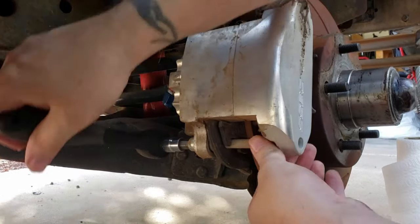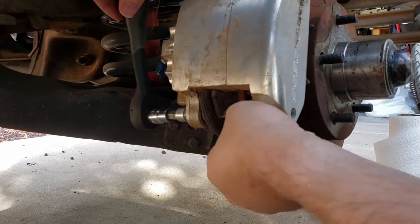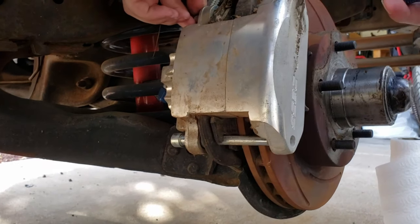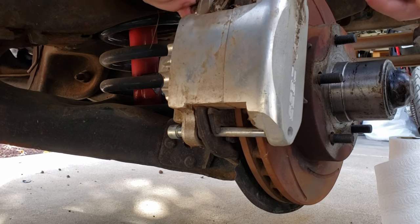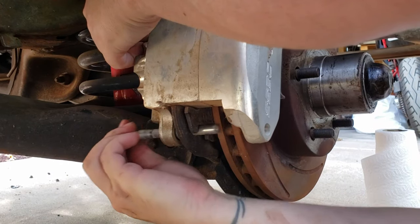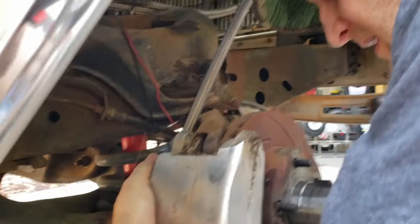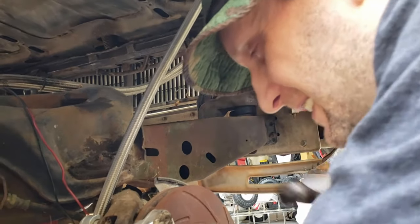I'm guessing they weren't lubricated. You can lubricate them with a little bit of petroleum jelly and it makes them work better, especially since your brake pads float on those two pins - they have to be able to float. This one's going out by hand so there's some lube on there. He did put some type of lube on there. Here comes the twin piston caliper - probably going to need to tap it with a hammer. Then a little on the bottom, a little more on the top - you have to walk them out basically.